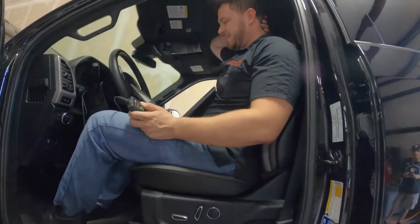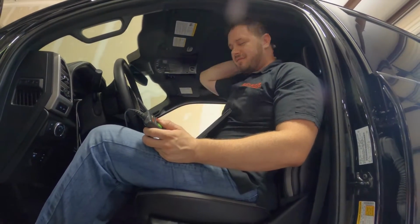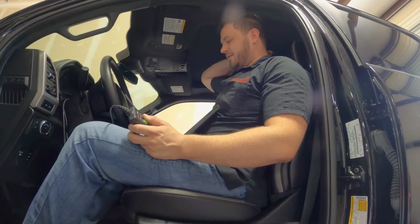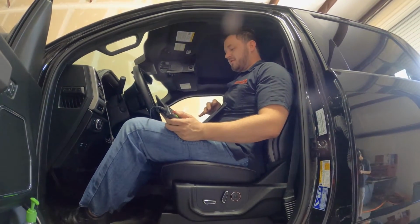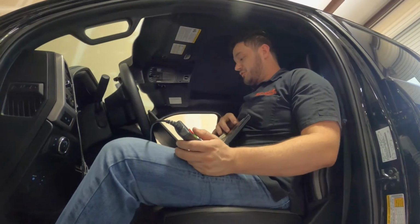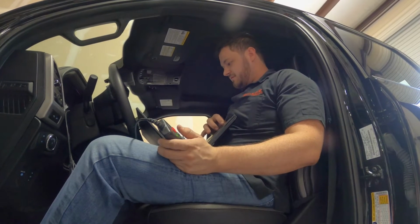Your speed limit is set to 100 miles an hour. It is? Yeah. Really? It shut me down at 100. So I'm gonna have to pull it in a lower gear just to get a bigger sweep. Is that set from the factory? Yeah, at 100. It's also going extremely rich as the pull continues.